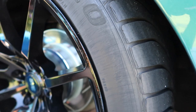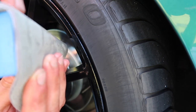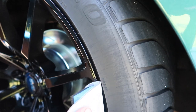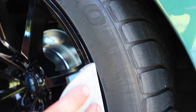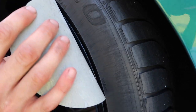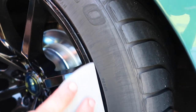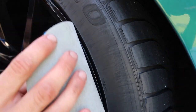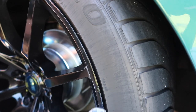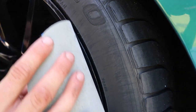It's been about eight hours since the paint was applied, so it's had some good time to cure. Now we're going to take some 3000 grit sandpaper, use this thin portion of the sanding disc, and just smooth it out a little bit to make it blend in with the original paint better. The trick to sanding successfully without leaving deep sanding scratches is to use no force whatsoever — just enough to get the sandpaper flat on the surface and allow the sandpaper to do all the work. If you press down, you'll put in deeper scratches than what that sandpaper is rated for, so they may not come out with the next stage.